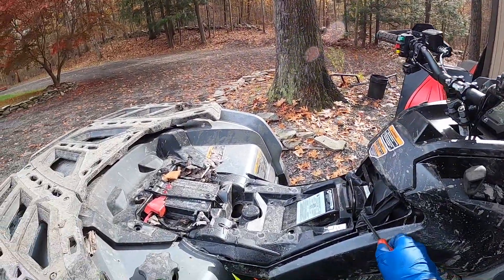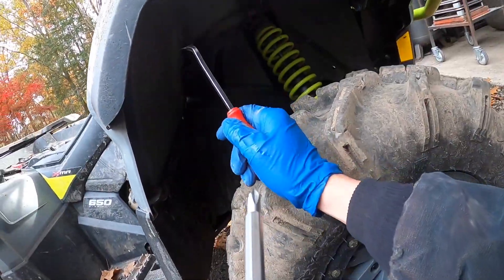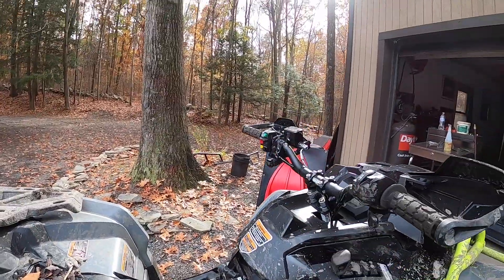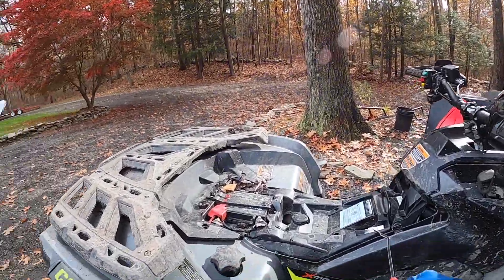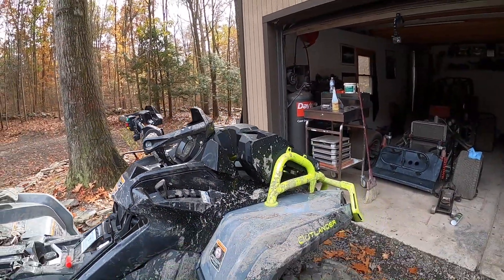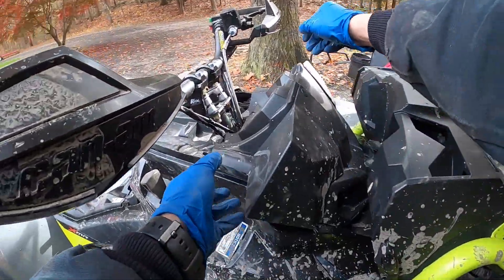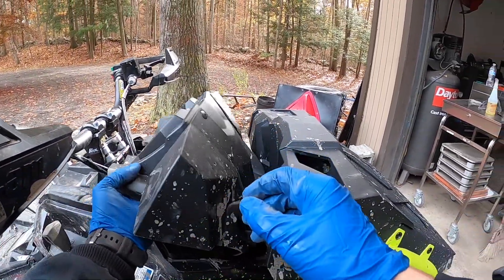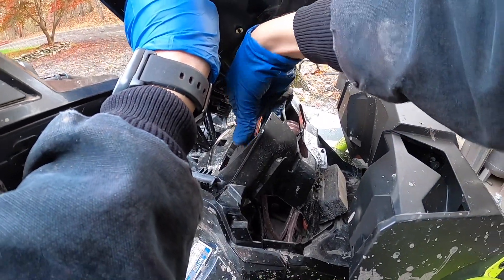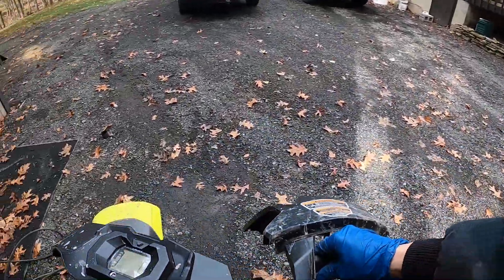With the Can-Ams you have a couple of pop pins - some of mine are missing, so if yours are missing already it's a little bit easier. On the right side of the quad you've got a pin there, one underneath, one more behind there. On the other side you have the same thing except there are a couple more pins down below. In order to get in there, you also have to pop this guy off and then there are a couple Phillips head screws right behind here. There's a little harness clip I like to stuff down in the air intakes to keep it dry.